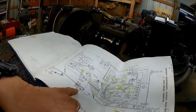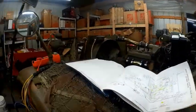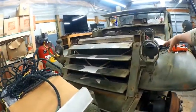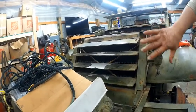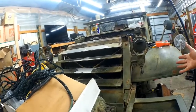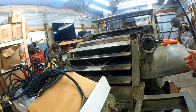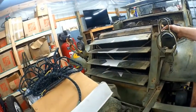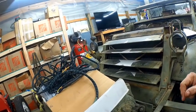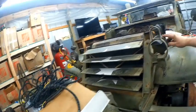They say they have a tilt switch here. A tilt switch is a dipper switch, right? High-low beams. When this half-track was produced in '43 and they pulled the original fender-mounted headlights off, they went to the pedestal-mounted headlights with protection, because they were losing the headlights off the fenders all the time, either through combat or just driving through the woods and stuff. It would rip them off. They had a high beam, low beam. There is no high beam, low beam for these. They just got ground, and you got a light, and then of course the wiring running up to your blackout lights for your drive.